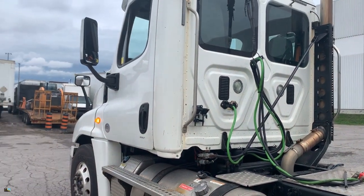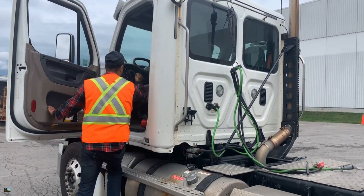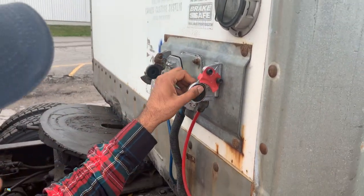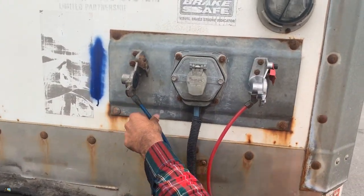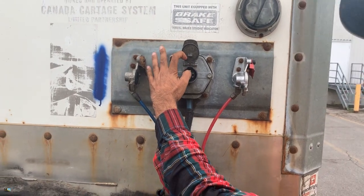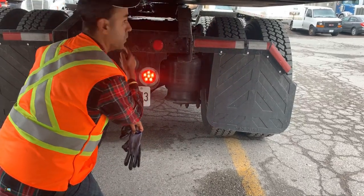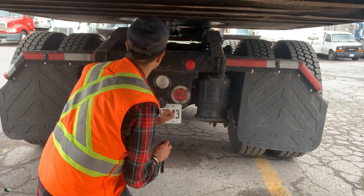Put it in neutral and apply the brakes. Come outside and tell the examiner: 'My trailer height is good.' Check your couplers: supply line coupler — no crack, no damage, rubber seals are good, tube looks good. Service line connection — no crack, no damage, seal looks good. All electric pins are there, none missing, none broken. Then go under the trailer. Say three things: 'My kingpin and my fifth wheel are lined up; my kingpin — no crack, no damage; and there is enough grease on the upper plate.'